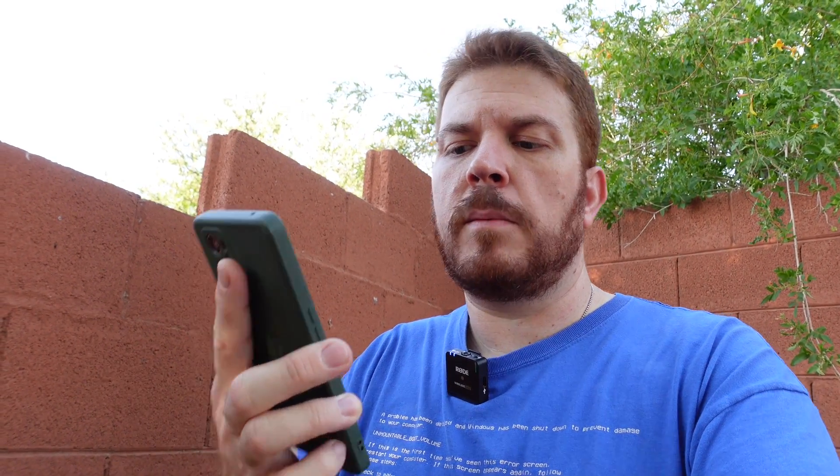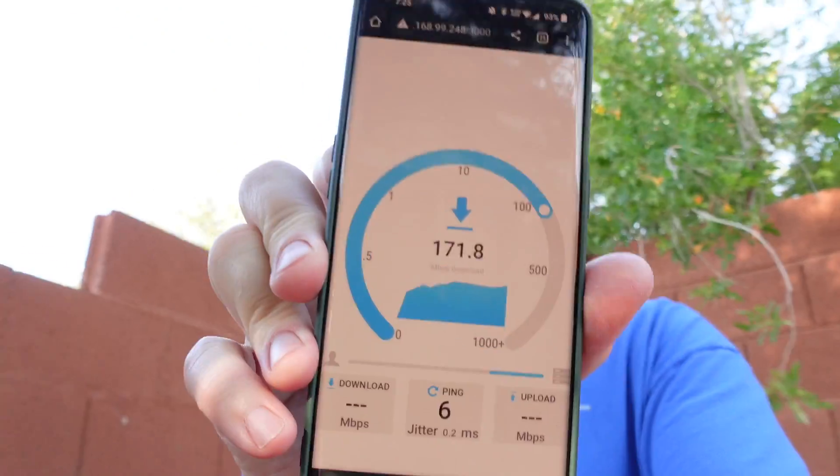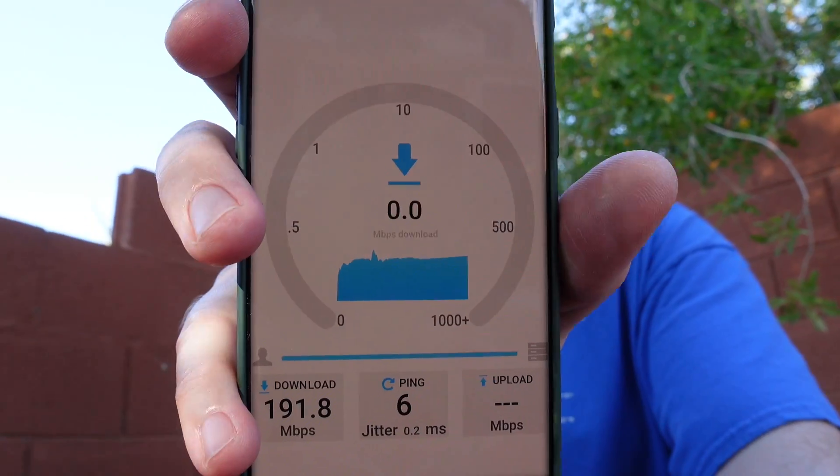Now I'm going to go ahead and plug this in outside and do some tests outside next. I am now in the furthest spot in my backyard, connected on the 5 gigahertz band on my Wi-Fi from my phone. I'm going to go ahead and do a speed test using Wi-Fi Man. That is 124.1 megabits down and 52.5 megabits up. Now running OpenSpeedTest, that got 191.8 megabits down and 41.3 megabits up. Now I'm going to go ahead and take the extender inside, just inside the kitchen door, and plug it in on the wall, then go back to the same place in the backyard and do another set of speed tests.